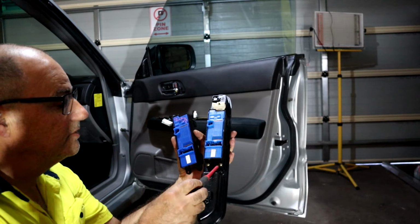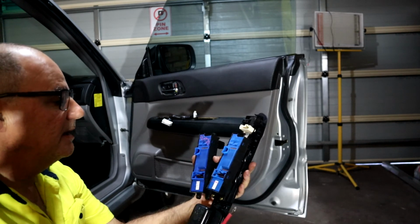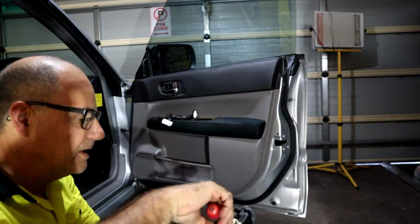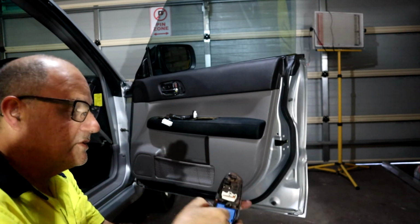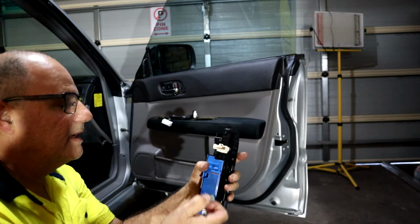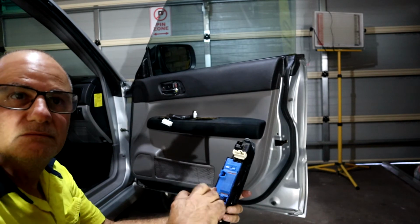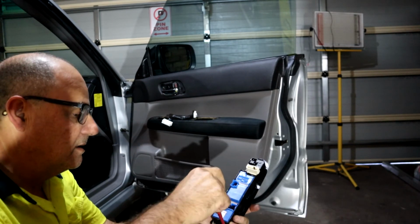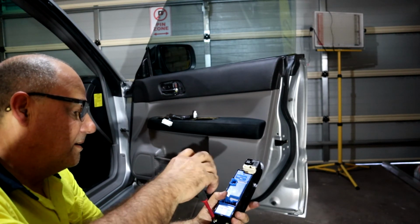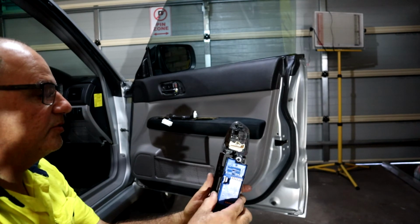I'm just going to unscrew the existing one and reinstall the replacement. There's 3 Phillips screws holding it in. There's a little tab on the top just where the power mirror connector is. Power windows, so don't lose that tab. Just take note of how it came out, because it's like an offset little, I don't know, bent, kinked. So removing the screws, this just pulls out like that.